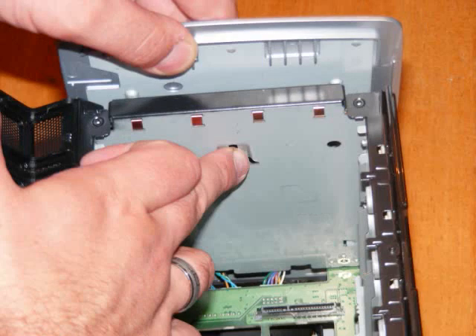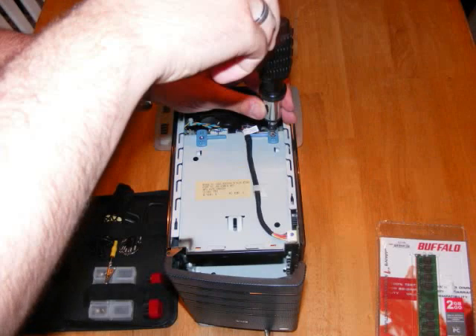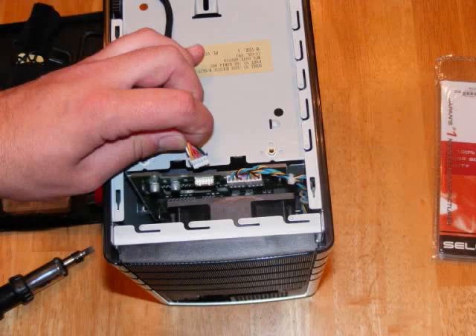The top button here will release the cover on the top. Push this in and slide up. That will reveal two screws. You can either untighten or remove these — I've chosen to remove them completely. Then remove the cables. There are three cables there; detach each one.